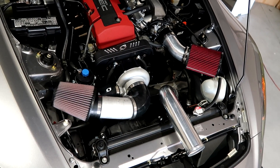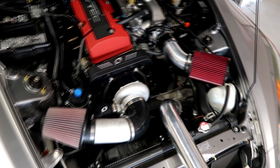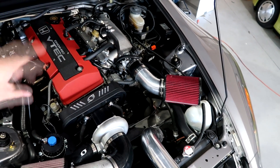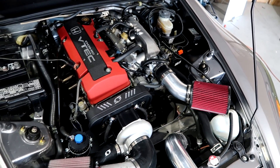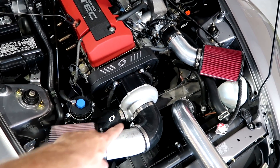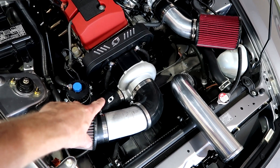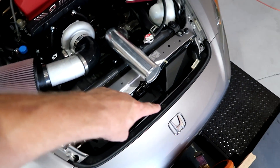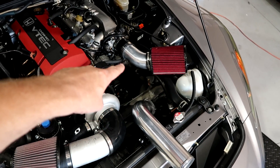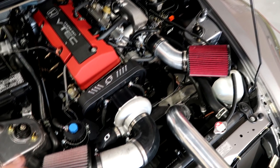At first glance this looks a little complicated, and after a few minutes it starts to look goofy — I understand that. So let me explain what's going on. This is the intake to the engine. The engine essentially doesn't know it has a supercharger on; it thinks it's going up an extremely long, tall hill because the engine is turning the supercharger. This is the intake to the supercharger, which would usually be there. This hose goes around through the air-to-air intercooler and back up to this tube, which would usually be connected here, so it creates boost on the engine.